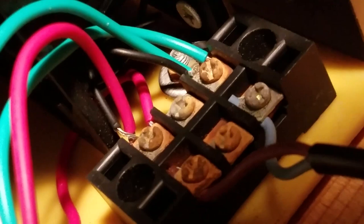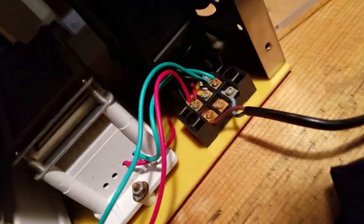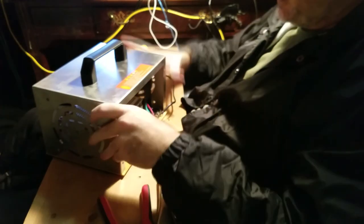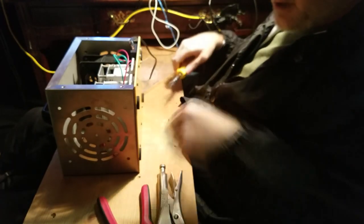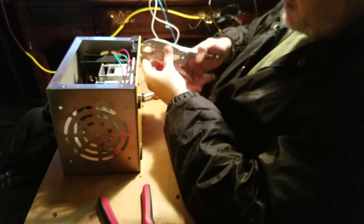And then I got some black wires in there. This wire right there, that black wire, maybe I can get, okay, there we go. The black wire there and the black wire over here, right there and right there, once again it's going to be right and left because they go to the fan, and that's all there is to it. These I'm not going to detach. That's the wall plug, and that's all there is to it. I'm gonna detach this connector, though, on account of it being a lot easier to access it.